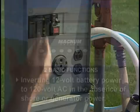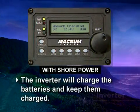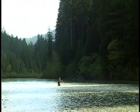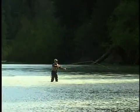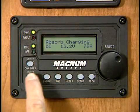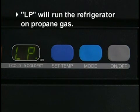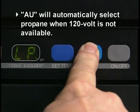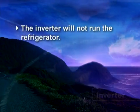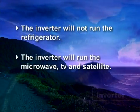Here are a couple of examples. Let's say you're camped at a campground and are plugged into shore power — the inverter will charge the batteries and keep them charged. Now let's say you found that perfect little spot near a river or lake with no hookups and you don't want to scare the fish with the generator running, but the big game is on and popcorn and cold drinks are called for. Turn the inverter on and set the refrigerator to LP or AU. LP will run the refrigerator on propane gas, and AU will automatically select propane when 120-volt is not available. The inverter will not run the refrigerator, but it will run the microwave for that popcorn and the TV and satellite for that big game.